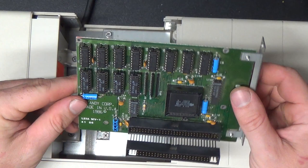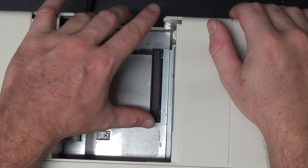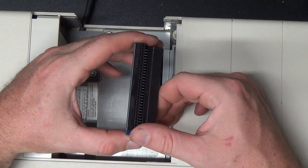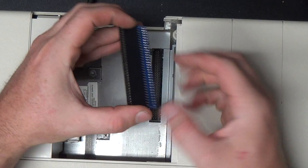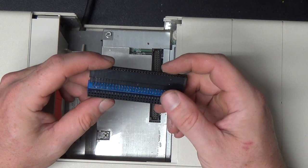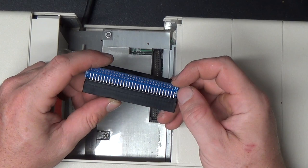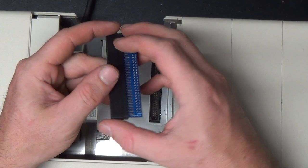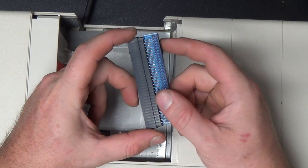But this is basically the ISA bus, with a couple of pins changed, but it's similar enough that you can buy or make these adapters to convert the plus expansion bus into a right angle ISA card here, so we can install like a hard drive controller or something with that contraption if we plug it down in there like that. It's a guy, I think he's in Australia, that makes these. If you wanted to make a bunch at the same time, it may be cheaper to just order PC boards and make them yourself, but for my purposes it was a little less expensive to just order this one. He also makes one that has two slots in it, but you can't use any other plus cards with it installed, because check out these plus cards.